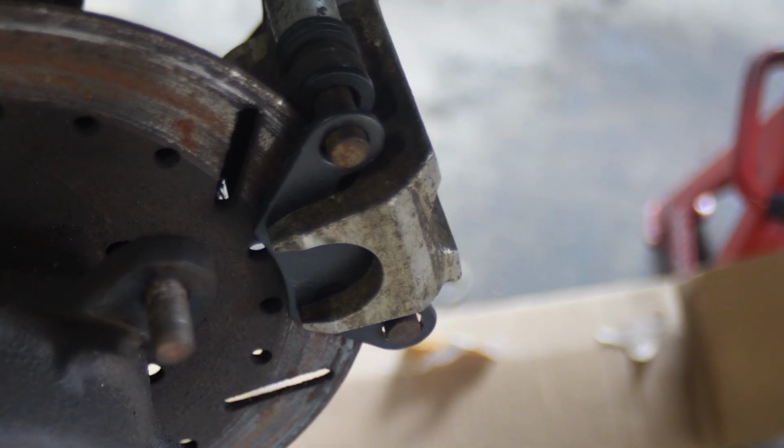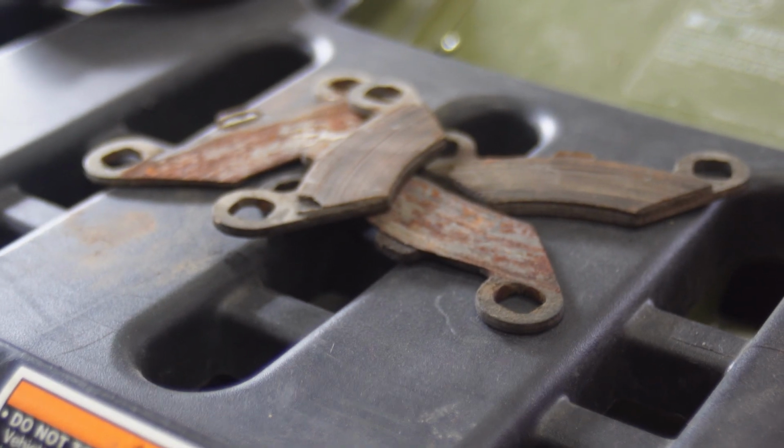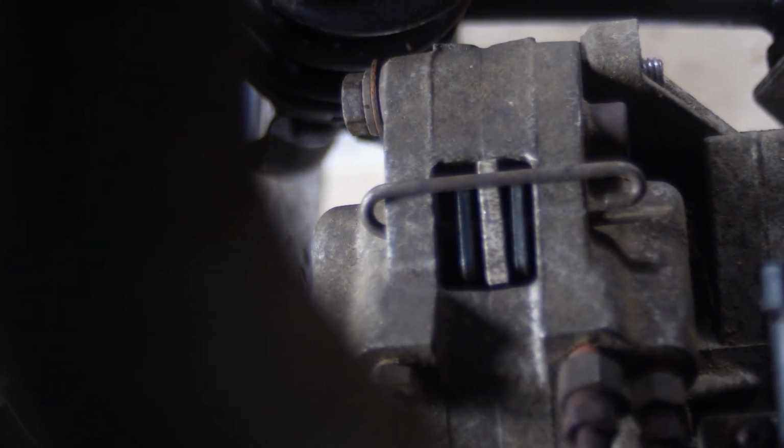Okay guys, we got the brake pads replaced. Front pads are in. Check out how bad these old pads were. They were terrible. Yeah, we kind of knew that already. Anyway, the rears were okay. Somebody had been there already. They left the bolts loose. We got those tightened up. Everything's back together. The pistons in the rear are not pumping up. Kind of expected that. The rear master cylinder is kind of suspect, and the front, I know it has air in the front brake system, so we got some bleeding to do. Let's get to it.